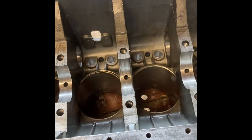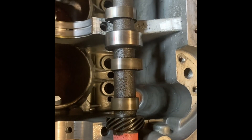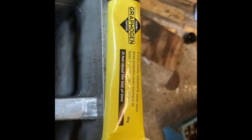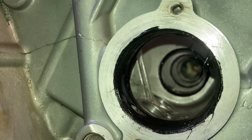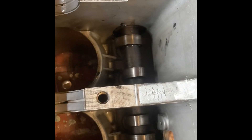And now we're going to start trying to get a few bits back into this engine. This engine block is just a standard rebuild, and this is the camshaft that's going to be going back in. Again, no signs of wear, no scores or anything like that. I was quite impressed with how good this was inside, really, for the age of the engine. I'm going to be rebuilding it with this graphogen paste — it's like a graphite paste you smear on wearing surfaces. I've put it on the inside of all the cam journals. When it has its initial startup after being rebuilt, it's got a good form of non-stick lubrication on all your wearing parts. So you've got the camshaft slid back in now. There's all the lobes turning — you've got one lobe for each valve, and in here the centre lobe operates the fuel pump, and then one lobe for each valve for each cylinder.